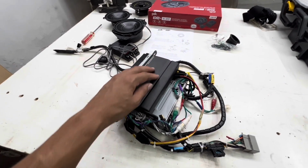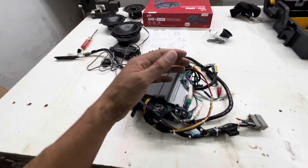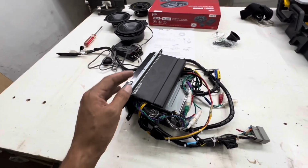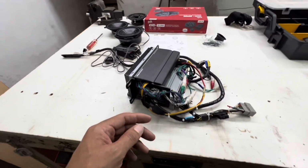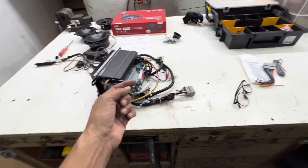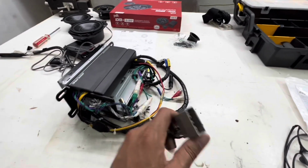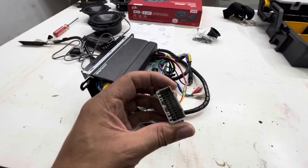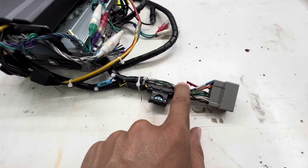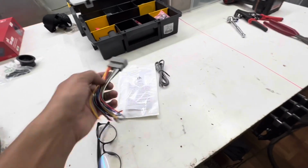No! My amplifier, for whatever reason, I think I've narrowed it down to the reason, but it's not getting power sporadically. It's not something you can predict. But I know that if the Jeep sits for a while and I get in, I turn the Jeep on and go to listen to some music, all I can hear is the bass from my subwoofers in the back of the Jeep, which are not powered by this amplifier. A few times when this has happened, I've pulled the stereo, and I've noticed that when I screw around with this adapter clip, which I got on eBay years and years ago, my speakers get sound all of a sudden. So what I did was order a new one.